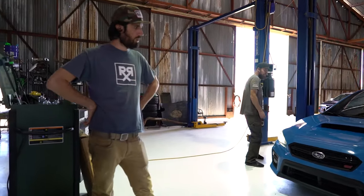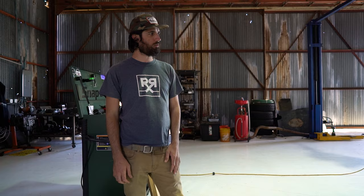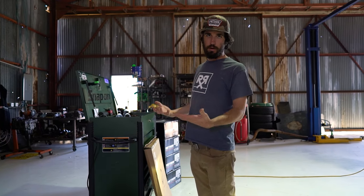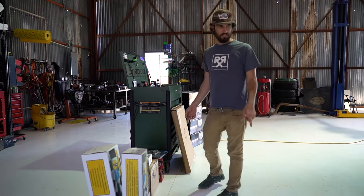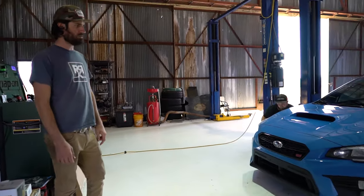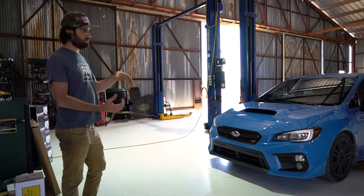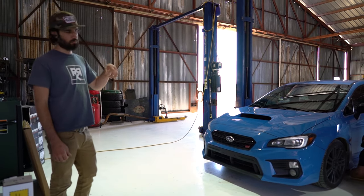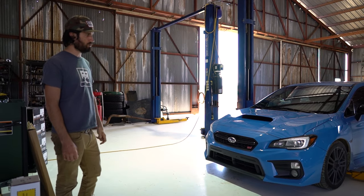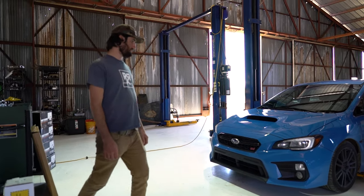Basically, all that we need for a recce car is suspension that can tolerate the sort of mild abuse of driving on the rally stages. We're always driving at like road speed for recce, so we're not going crazy fast. But basically underbody protection, upgraded shocks and springs, some mud flaps from RokBlokz, and then because the STI has the big, these 18s? These are 18s, yeah. Has the big boy wheels and tires. We want to downgrade that to a rally wheel and tire. So that'll be a 15-inch wheel, and in order to do that, we have to downsize the big Brembo brakes down to the four-pot, two-pot style Subaru brakes. So it's a pretty straightforward build.